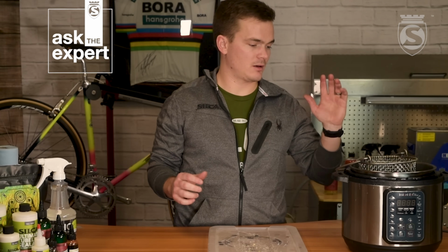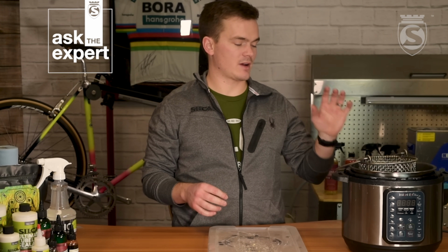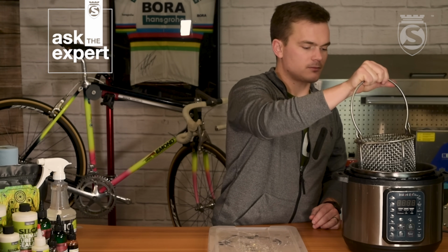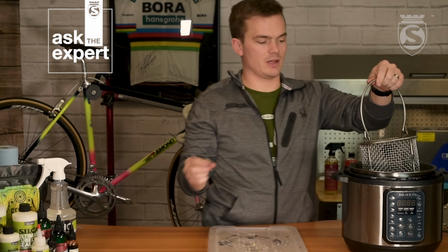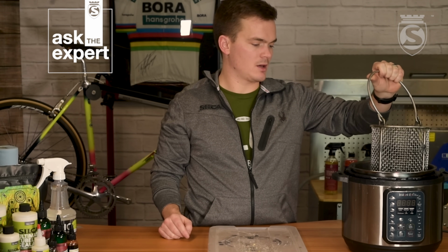Alright, now we have the wax that's cooling. We're getting really close to being able to pull it out. As it's cooling, what we're going to try to do is keep mixing it around a little bit, that way we don't get any too coated on the sides. Really all you're trying to lubricate here is between the inner and outer plates. That's where the friction is happening.